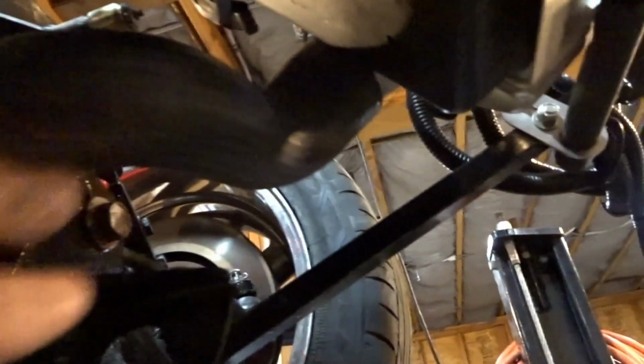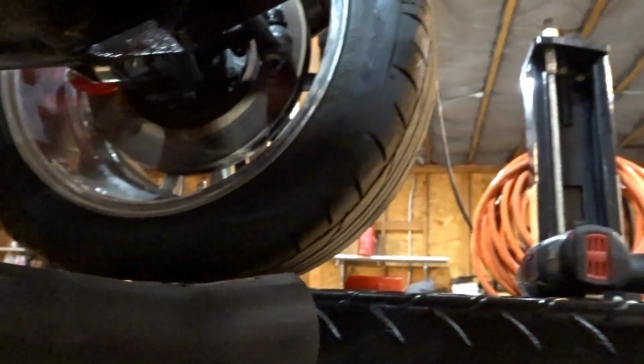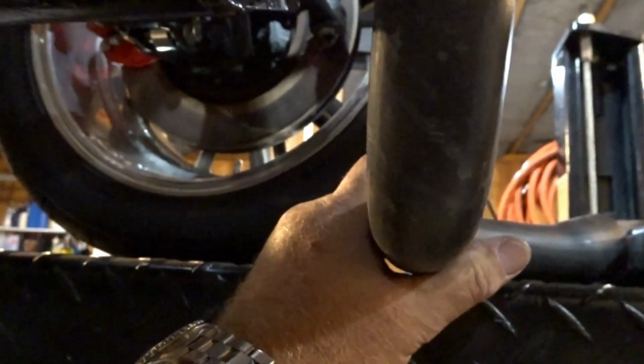Haven't done anything with the upper ones yet, but I was really worried about these bottom ones because this is 1.75 inches and this is 1.5 inches. And so sometimes trying to adapt that, I didn't have a whole lot of options for this hose. I did have another hose here that had kind of the same configuration. The problem is it would have pointed me this way, basically straight towards the passenger side of the car. And I didn't think that was going to work, and I thought if I put it this way, it's going to be way too, I mean, you can see how low it would have been in the car. I'm sorry to bang the hoses against there, but anyways, so that's what I'm going to be working on probably over the next couple of days, getting all of these hoses done.